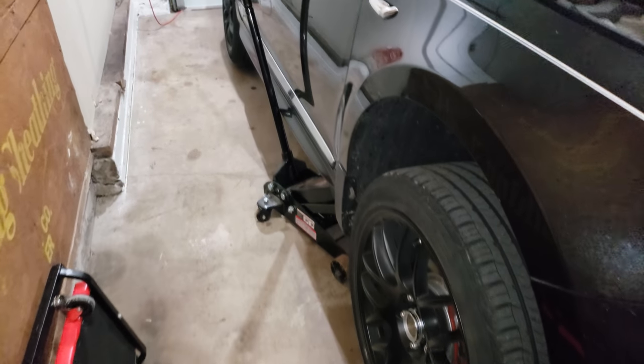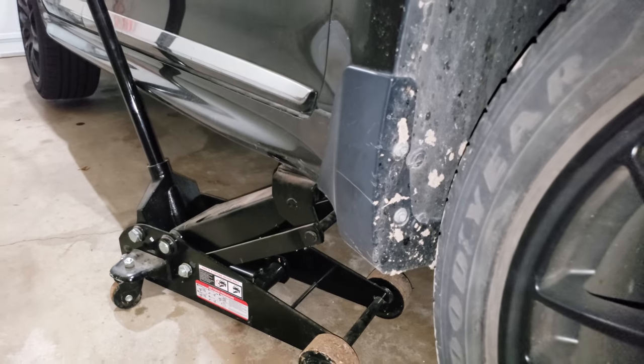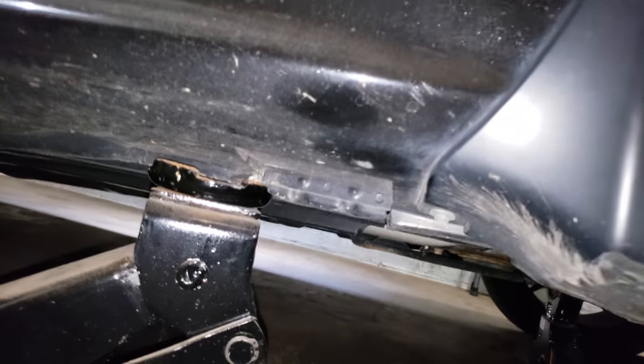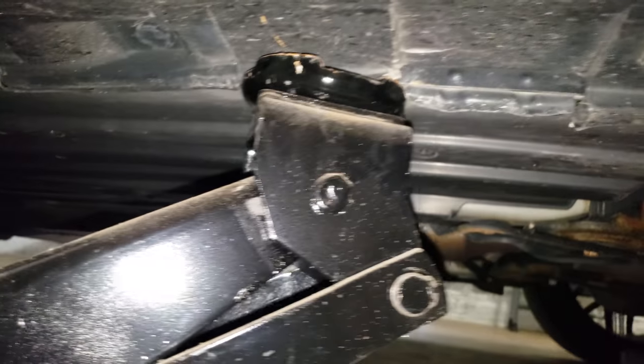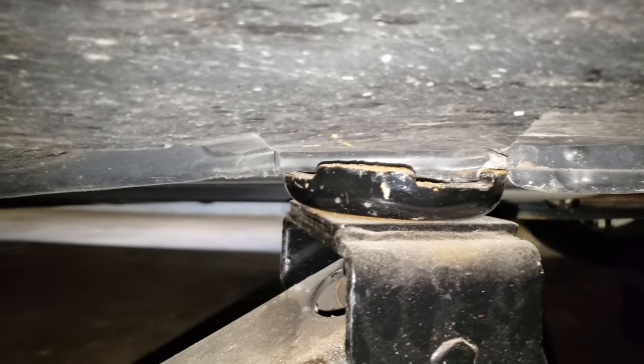If you're not a large guy like myself, you'll only need to jack up the passenger side — no sense in raising both sides of the car and putting it on jack stands. Most cars underneath will have an arrow, or sometimes there'll be notches dug out below that show you where the frame of the car is and where you should connect your jack safely.